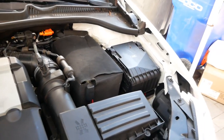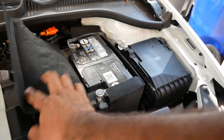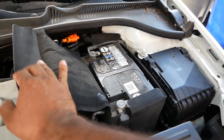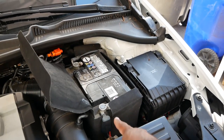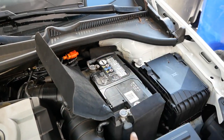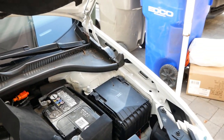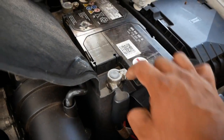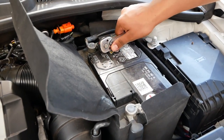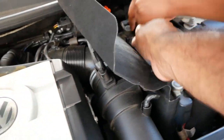For the first step, pop your hood open, turn off your car, take this little battery cover off and you're gonna pull out the battery. First thing we need to do is disconnect the negative then the positive using a 10 millimeter socket or wrench — socket preferred. Disconnect these right here, there and there. Just be careful not to touch the positive with the wrench.